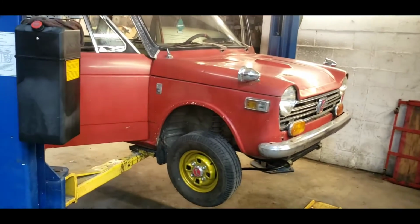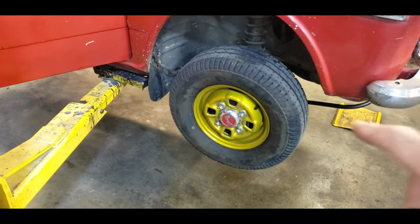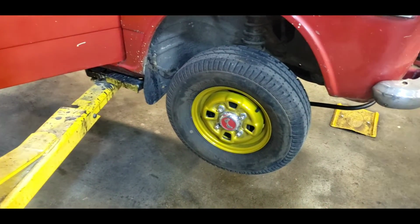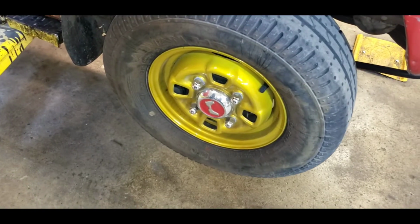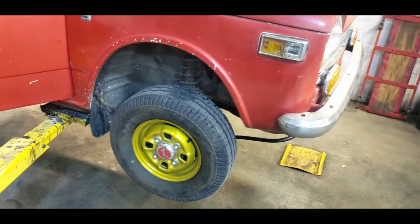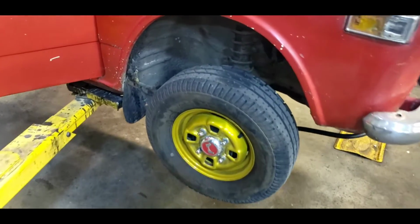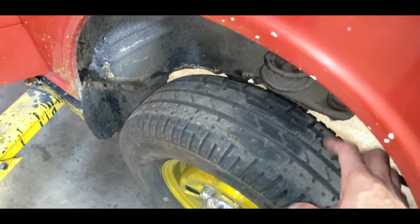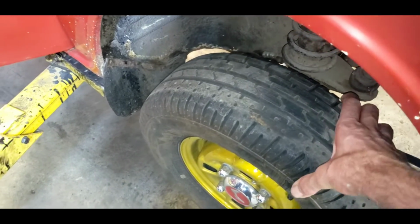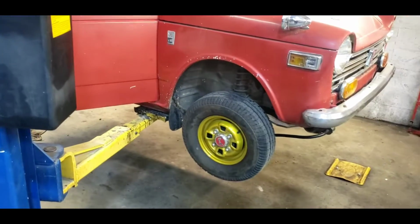So to recap, we got the new wheels and tires years ago. Those rims are off of the Z car with the holes in them, the sportier car. They're still 10-inch, but we put the Mini Cooper tires on there, the Yokohama A008s. They're super sticky. They're 165/10, so they got a real wide tread width, and they fit on the Hondas really well. Super grippy. Really impressed with those.